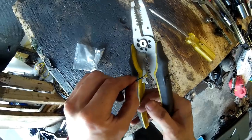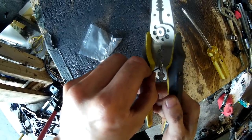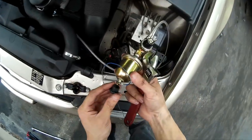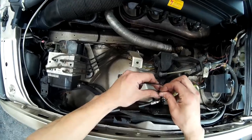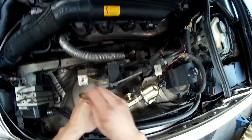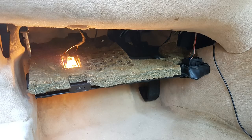After that I started the car and made sure there were no oil leaks - that's pretty much everything you need to do on the oil side. After that it's just connecting wires: one wire from the oil pressure sensor to the oil pressure gauge, and another wire from the oil pressure switch to the instrument cluster to light up a warning light when oil pressure is low. I placed the sensors underneath a plastic cover in the engine bay to make it more hidden, just wire-tied in place.